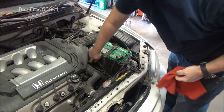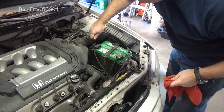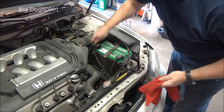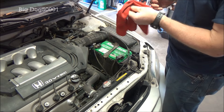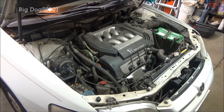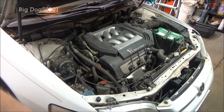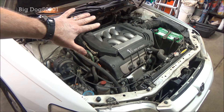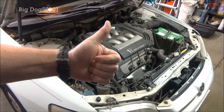It's been one minute — we'll pull the dipstick, wipe it off, and make sure it's fully inserted. There you go — that's how I do a transmission service on these big V6 Accords. Always double-check your work: look underneath and make sure there are no leaks or drips from the transmission. I always give it a once-over before letting the vehicle go. If the video helped you out or you liked it, make sure to give it a thumbs up. Thanks for watching.